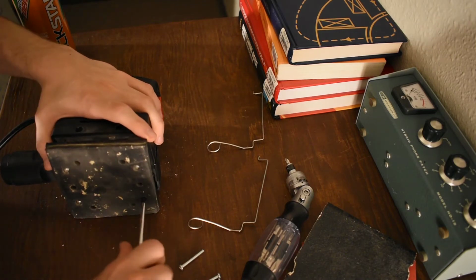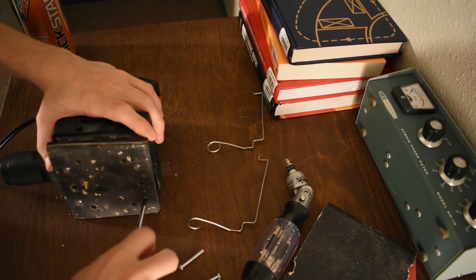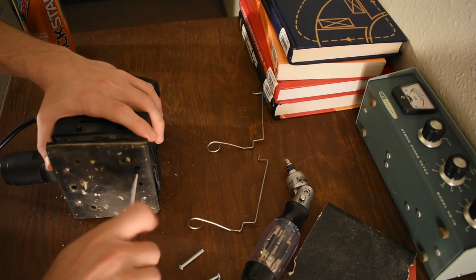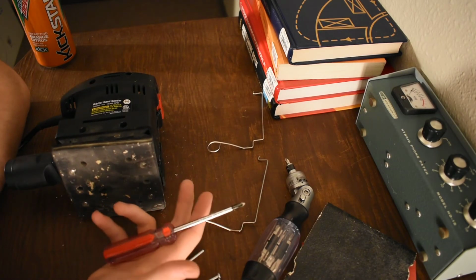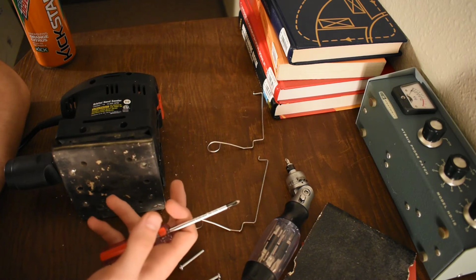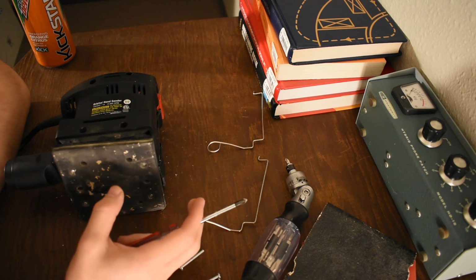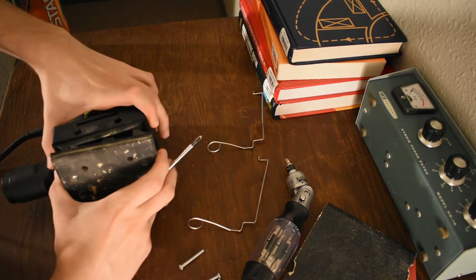But it's expensive because the glass fiber is super abrasive. So when they mold it, it wears out the mold faster. There's stuff they do to mitigate that sometimes to make it cheaper. Making a mold, if you've ever looked into it, is really expensive. These mold makers machine it and all this stuff, and I looked at a quote once for this little tiny motor housing, and it was gonna be like $30,000 to do the mold making, and then they'd cast it.